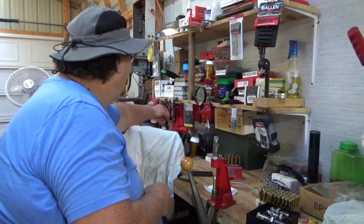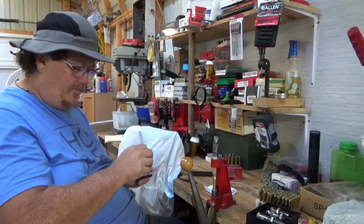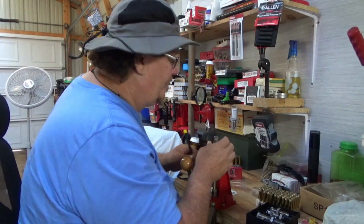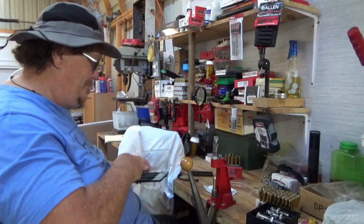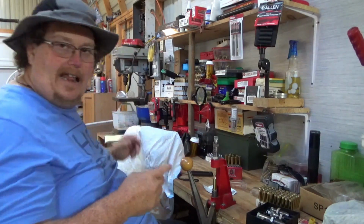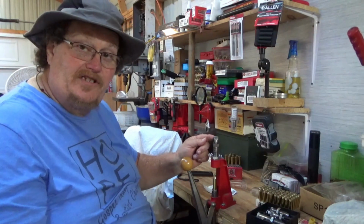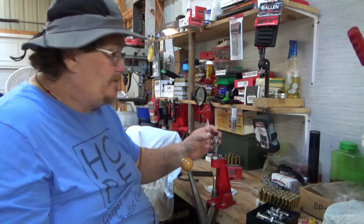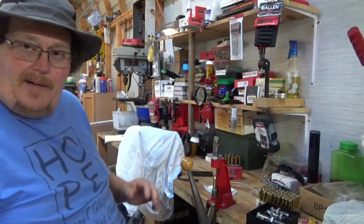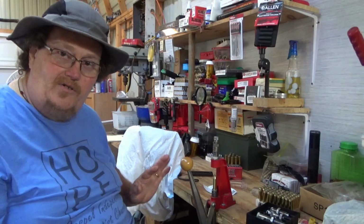So here's something that I do: I'll take a punch. These are aluminum, so it's easy to do. And I'll scribe me a little line on there, just anywhere, it doesn't matter, because you're looking at that line as your point to reference off of. So if you're going to screw it a half a turn, you take it from the side it's on right now and put it opposite. So I'm going to turn that so it's pointing on the opposite side. Okay, now that might not necessarily be exactly the expansion that I'm wanting, but it's going to get me started.